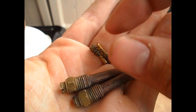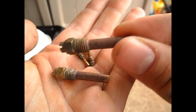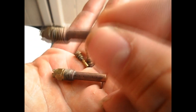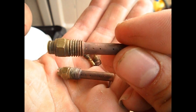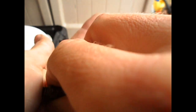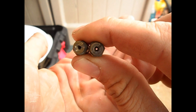Alright, all my jets are nice and clean. A couple of tips: when you're checking to see how clean the passageways are, you want to check for roundness — it needs to be consistently round, no lumpy spots or straight edges. And all the holes should be symmetrical across the opposite side, so the holes should look exactly the same as far as diameter. Holding them up is a good way to compare and make sure you're working with about the same size orifice on each side.